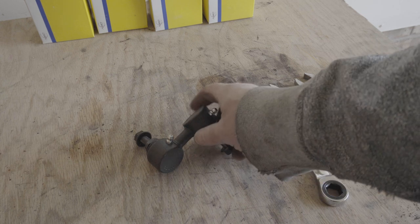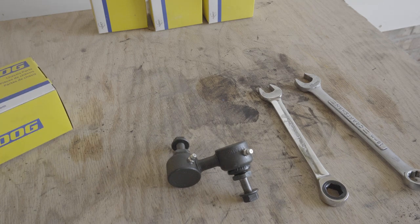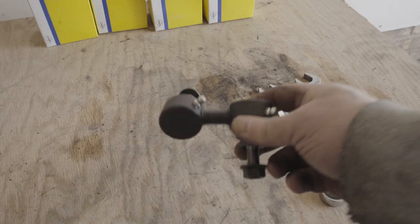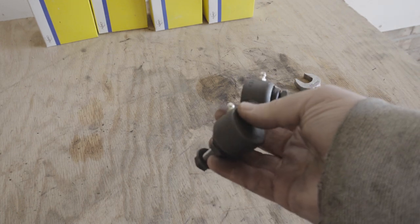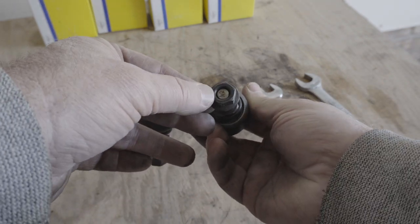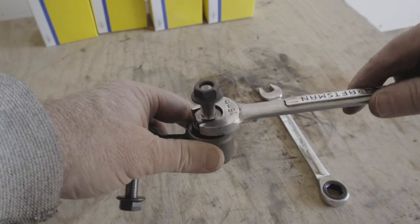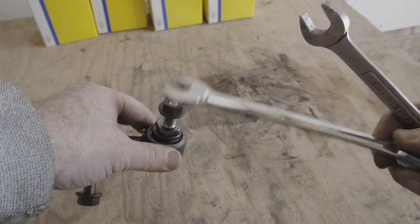This is the aftermarket part I decided to go with — they're made by a company called Moog. What I like about the replacement is that it has grease fittings, so if things start to get a little noisy down the road you can just grease them up. It also doesn't use the Allen wrench method; instead you hold it at the back with an 18 millimeter, and the top nut is now 15 millimeters — not 14 — so you can tighten or loosen it without the shaft spinning.